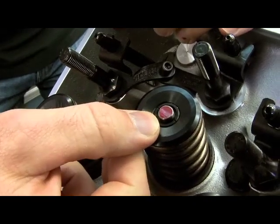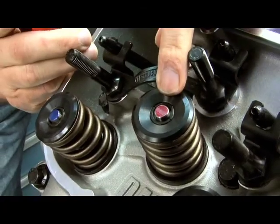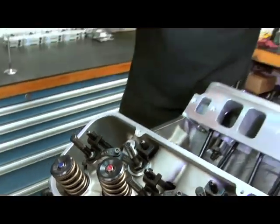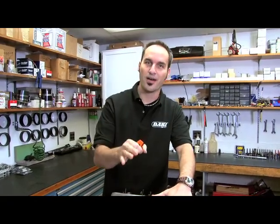If you're a little too far towards the edge, shorten your pushrod to move the pattern the other way. If you're too short, lengthen the pushrod to move it towards the outside. That's going to make sure everything gets nice and loaded properly, you make all the power you want, your valve train components are going to last a long time, and you're going to go out there and have a lot of fun.